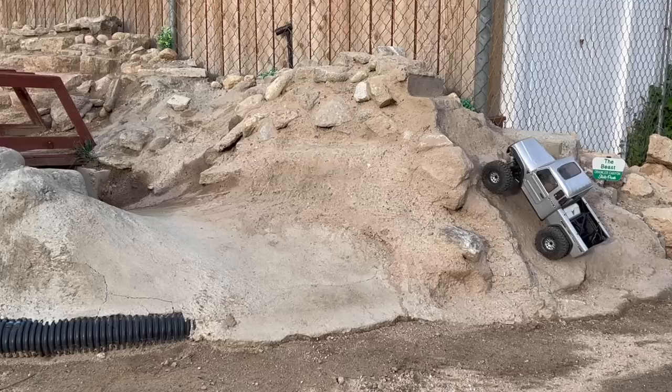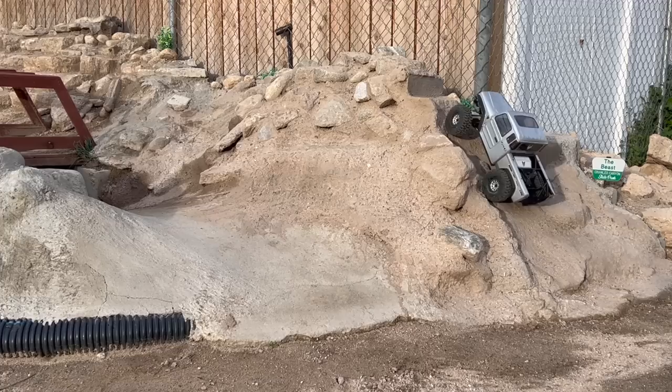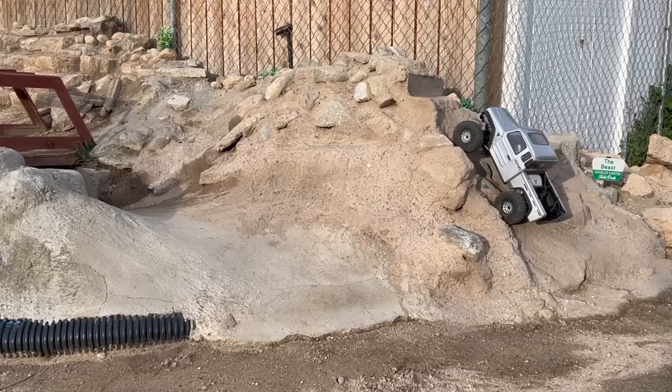didn't mess with the oil, nothing. Bolted them on, went one hole higher than how it was on the 80s. And I get that can't be it. It's just that there's either more oil or oil that's more suited to it. Anyway, before we get into a long performance-oriented discussion on tuning your vehicle, I haven't messed with link lengths. I basically tried to approximate what was coming off of the other chassis. Is that the optimal setup? No idea. We will get there.